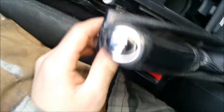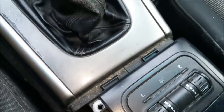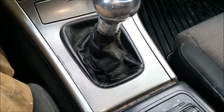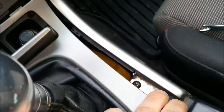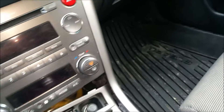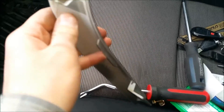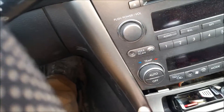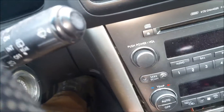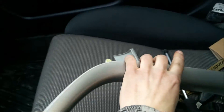So I've got the screws out, got the e-brake boot off. You need to pull it out a little bit — there's a clip in the front — and I actually got the whole center console off now too. And then it'll just pop up the shifter surround. So that's off. It comes off pretty easy, so you don't need to force it. And those are the two screws you need to take off to get those side pieces off. You're going to want to pull it straight out — try not to bend it. It's a little bit hard to show with one hand, but there you go, they're off.